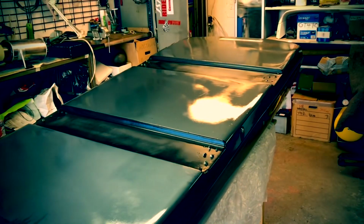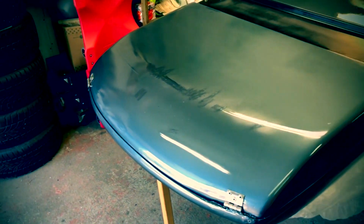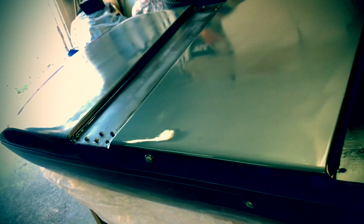So that doesn't look so fancy as you can see, but at least I'm covering all the dings and scratches so the paint doesn't fall off. The most important thing is the clear coat. I'm gonna cover the whole bottom part with at least three layers. I was just going on and on. So I'm satisfied with the bottom part. It's not supposed to be show car spec, because it's just supposed to take weather, wind, gravel and sand and all those things underneath. So we're gonna flip this over next time I'm here when it's dried off, and make better work of the top part to make it look as good as possible. So that's that for this part.